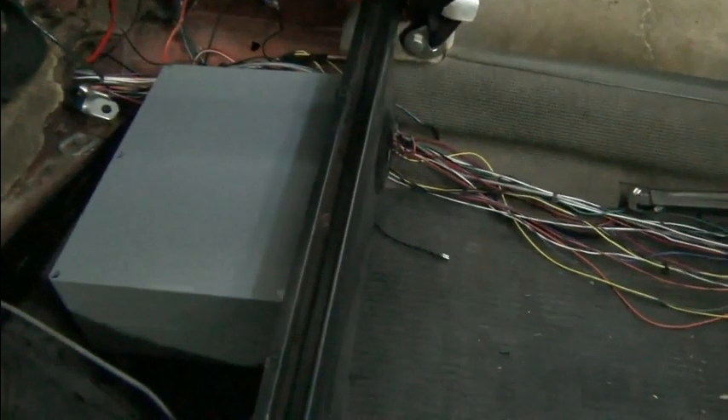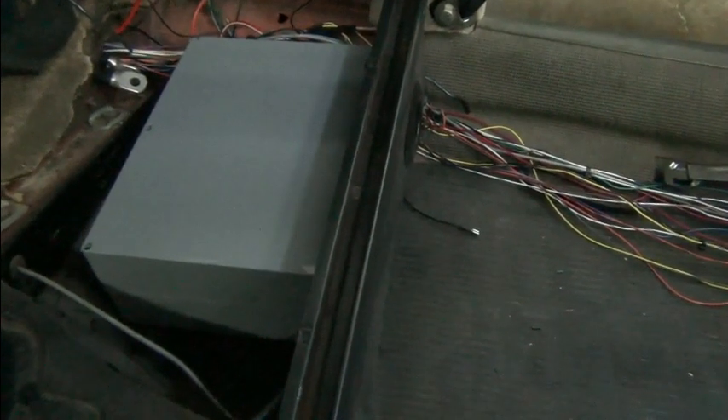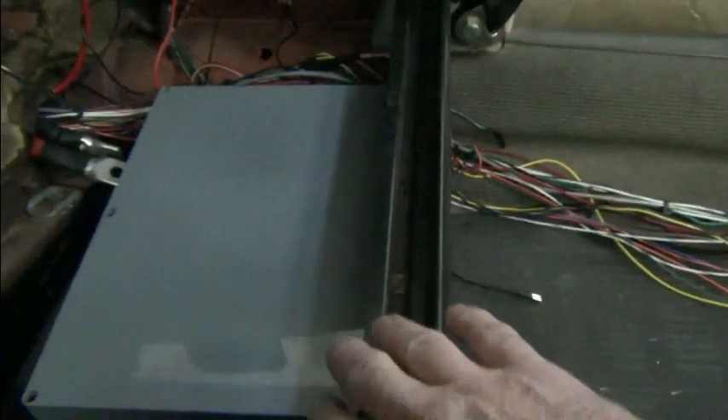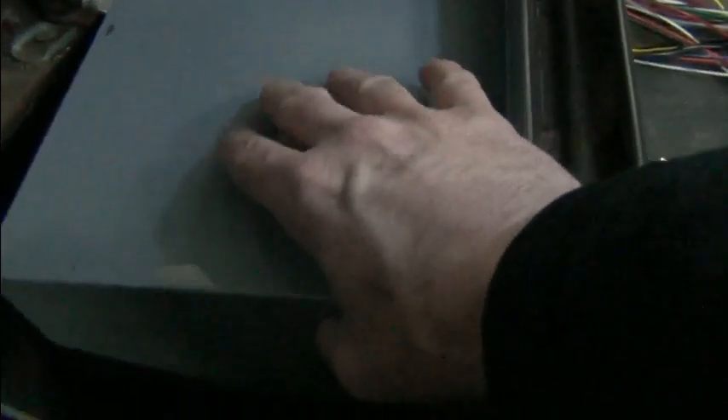I don't have an answer at the moment. If you look where the cable is coming through, it comes in really high on the box. That's double-ought cable and you can't manipulate it much. We also can't raise the box up because the back seat sits here, so we can't come up very much at all.